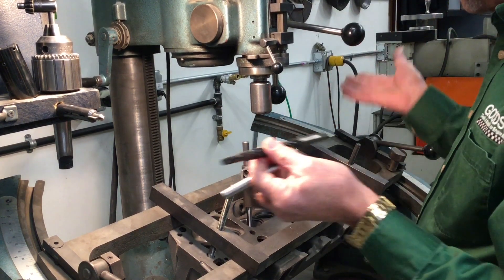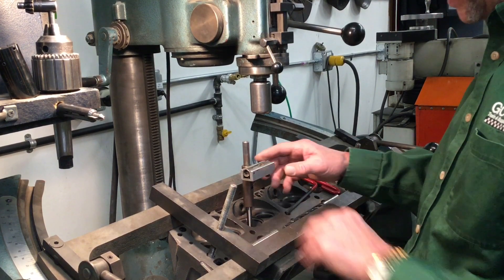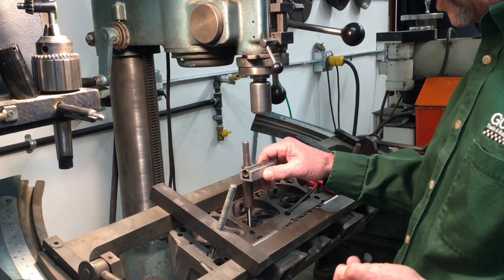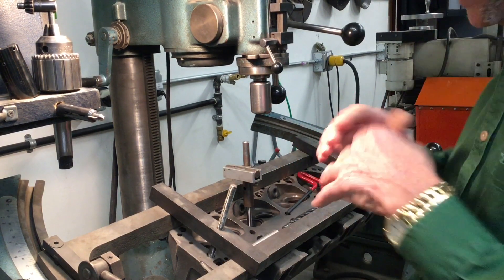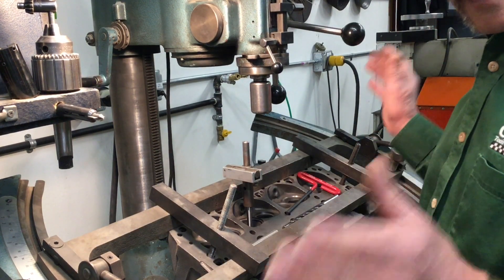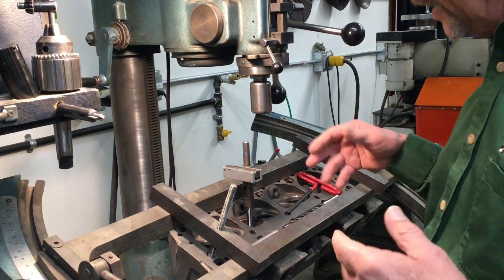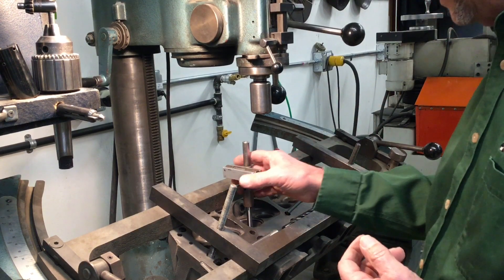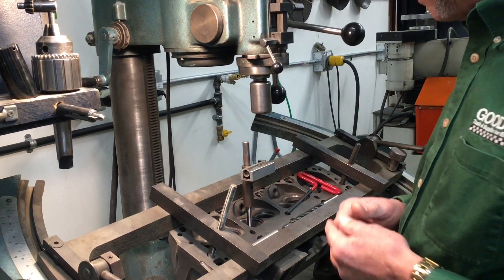I've got a Winona PH2000 seat and guide machine and I've just gone through the process to level it front to back and left to right. It's important that we keep all of our machine tools level as perfectly as we can every day — check them weekly, check them daily. If you're not leveling correctly, you're surely going to have some problems.